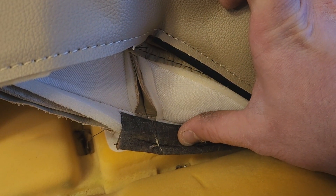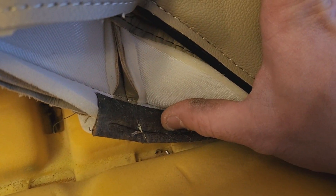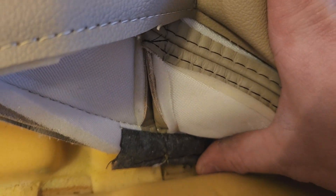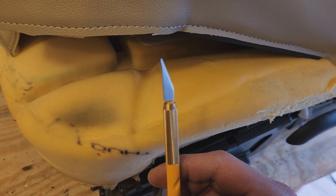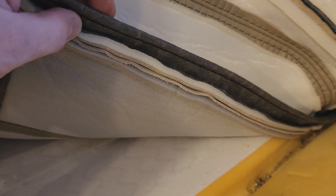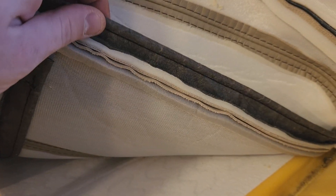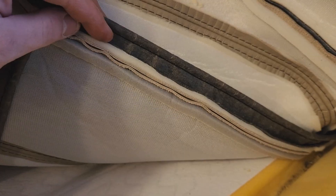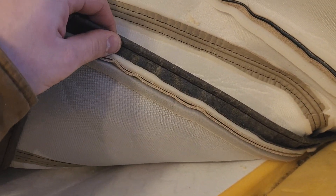On my new seat fabric, unlike the old one, this reinforcing fabric that the rings are supposed to grab doesn't actually have any holes in it — that's probably to give you flexibility when adjusting. What I'm going to do is for every place there is a metal ring, line up this support section and poke a hole through it with my exacto knife. Critically important: when you poke your holes, do it on the other side of this reinforcing lip here — there's a rope or cable in here that the rings actually grab onto. Do not poke through that; poke through the flat section behind it, and that way the rings will have a strong secure thing to grab onto.